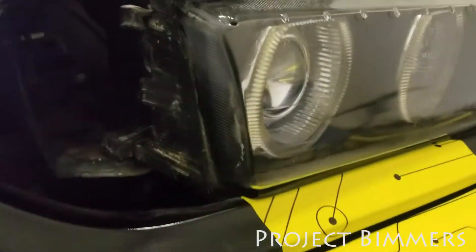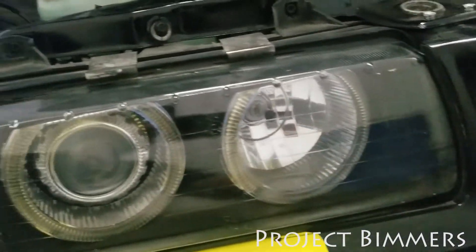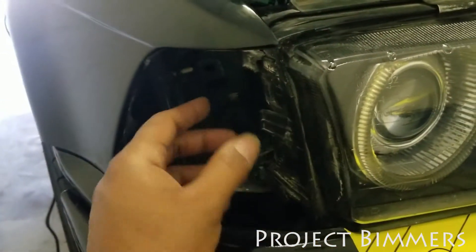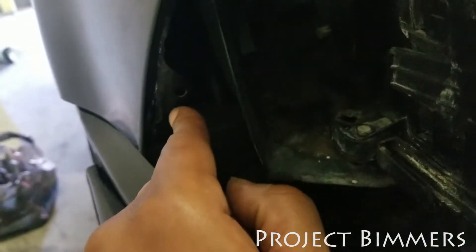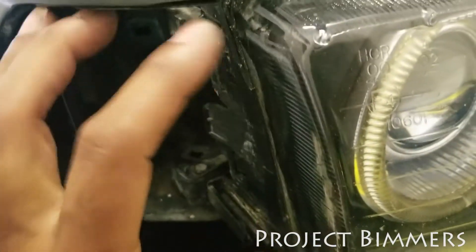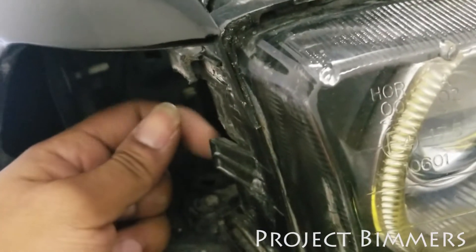This is just to give you an idea of how to get this light out — some people might not even know how to do that. You have some corner lights on this right here. You have to remove the corner lights first — that's very simple. They don't have any screws or anything, they just clip. There's a little hole here that the tab goes into, and the light itself slides into this area. It's just a locking mechanism — you unlock the tab and the light comes out.